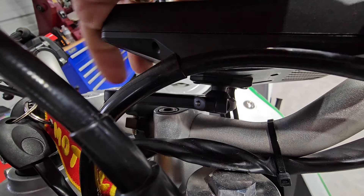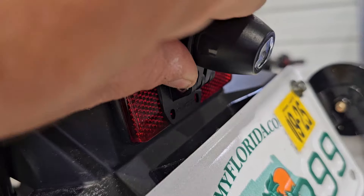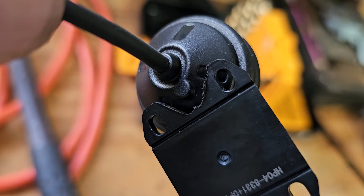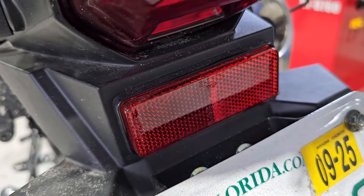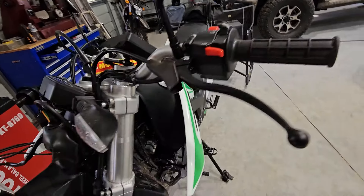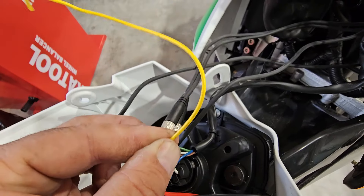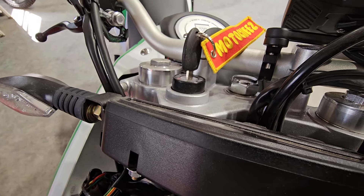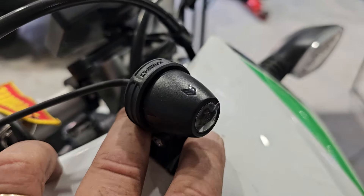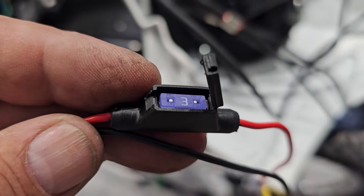The back camera is the one with the longer cable. I'm going to mount it probably on top of that reflector — I might have to notch that plastic a little bit. That camera will flip up like that, that should work. A little grinder action, get some alcohol, clean it off really good, put your 3M sticker on. Get the wires run all the way up into the front. Cam F is front and B is back. This does have a 3-amp fuse.